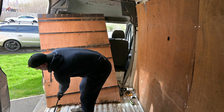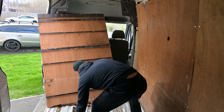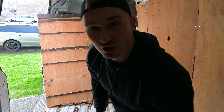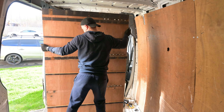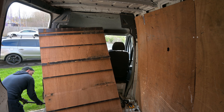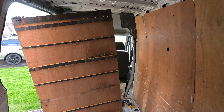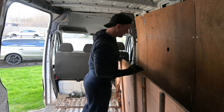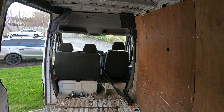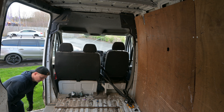I'm having to use a crowbar in this scenario because it was just a nightmare to get the floor up. If you're going to do it yourselves, get a crowbar — it's fantastic. Prop it underneath where the old wood was and you're looking to snap it or rip it apart to get it out of the van. Unless the wood is brand new, just get it out and start fresh. I reckon that floor had probably been there for a good 10 years.